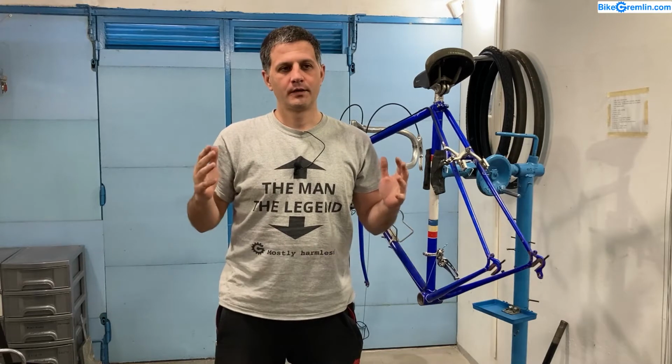So first, what kind of bicycle would I recommend for heavy riders? Like over 100 or over 120 kilograms and further on. Get a low budget, very simple bicycle frame without any bells and whistles like hydraulics, shock absorbers, anything. Just get a basic bicycle model. Put some good, strong wheels with 36 spokes, and make sure that the rear wheel has a Freehub mechanism, not a freewheel. And at least make sure that the front brake is a decent one.